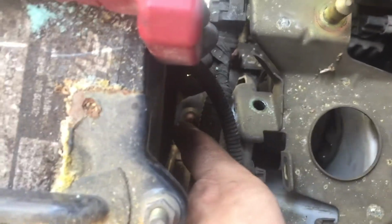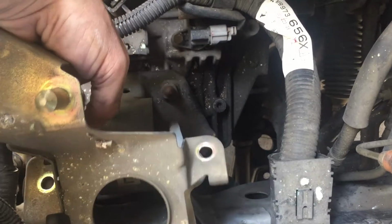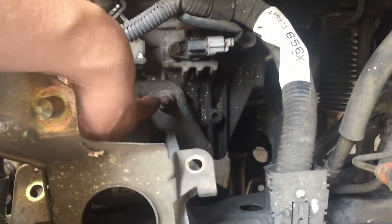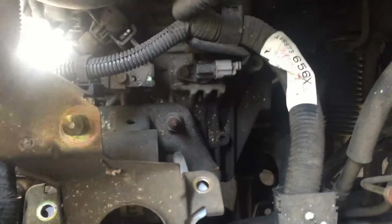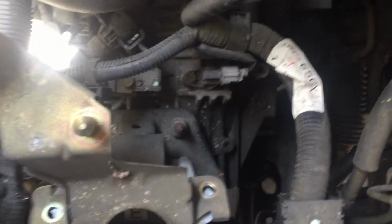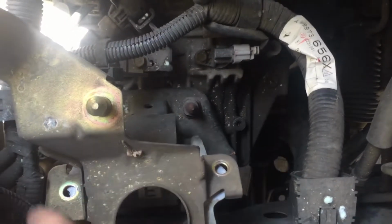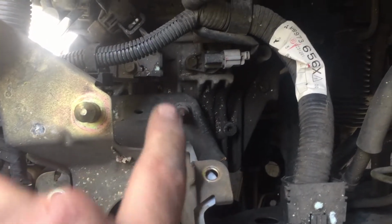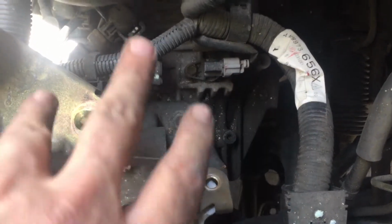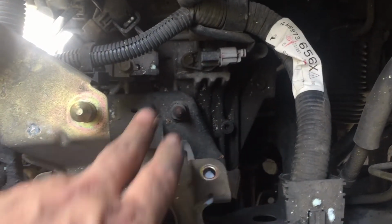1, 2, and there's a little hidden one right there, 3, 4, and then there's a fifth bolt that goes all the way through here. I'm thinking releasing the transmission from here and then undoing this one to relieve the tension off of it. Probably do kitty corner, here, corner, there, something like that. But not do all of them. Don't just completely drop. See how much of the transmission actually just drops down, because I might need to jack it back up to reattach those.